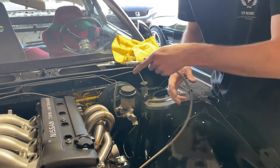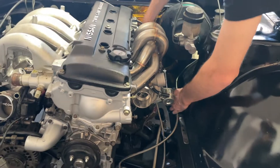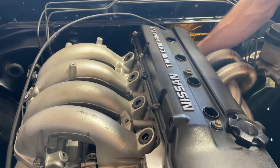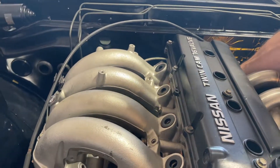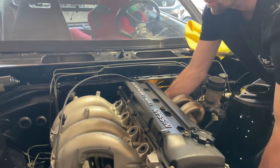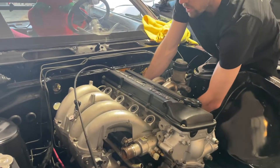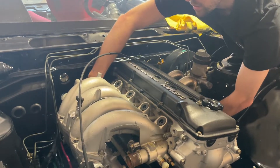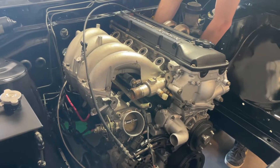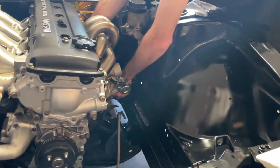The other line we've got is the coolant line. This one is going to go around the bell housing as well and end up going to the upper radiator hose. If you've got all your emission stuff deleted on the intake, you've got a little more room to play with for routing. If not, you might have to find a nice place to feed it through on the bottom. I'm going to end up zip-tying this or putting a hose clamp somewhere so it stays out of the way of the heat.